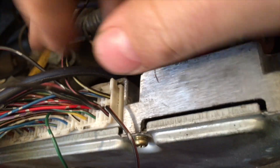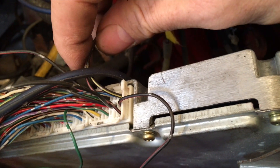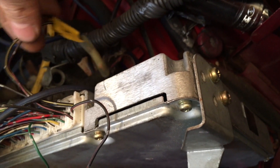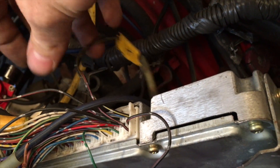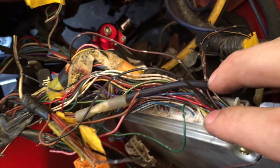For the ECU, I have a Crown ECU. The ones I had to do were battery — which is this top one — and plus B, which is this red one. I hook that up through a fuse and it goes to the fuse box. So then you have power to this one and this one: plus B, battery.